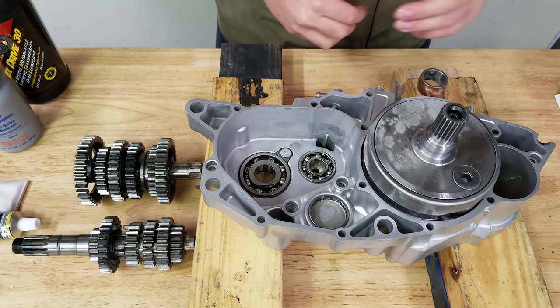What's nice about this spray sealer is that when it comes time to remove the old gasket, it comes off really easy too. We also went to extensive measures to surface these cases so they should be perfectly flat with no leaks. Before we spray the gasket, you want to get all your bolts ready — when that stuff cures you want to be ready to tighten them down. So let me show you this DBC bolt kit. A bunch of you guys sent DMs asking if I'm running a stainless steel bolt kit and where I got it.